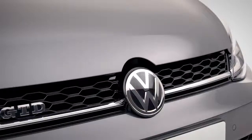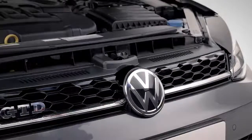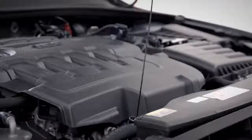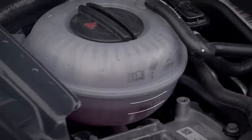Fluids. You'll need to open the bonnet by pulling the lever in the driver's footwell. Make sure you're on a level surface and the engine is cool before refilling any fluids. Then lift the bonnet lever and open. You should regularly check your engine oil is in the lower section of your dipstick and your coolant level is between the markers on the side of the reservoir.